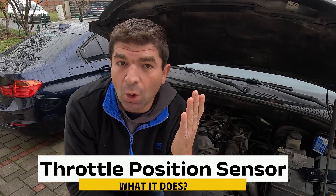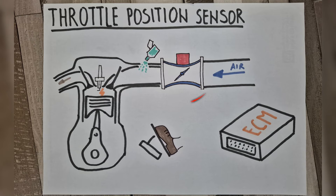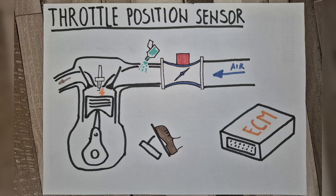Now, the following question is: why does the throttle position sensor need to be reset in the first place? The throttle body controls how much air is going into the engine, which ultimately determines its speed. This is done by a plate inside it, which opens up when you hit the throttle and closes when you release it. The car's ECU must know exactly how much the throttle plate is opened to correctly adjust the air-fuel mixture for optimum performance, and that's where the throttle position sensor comes into play. It tells the ECU at which angle the throttle plate is at any given moment.